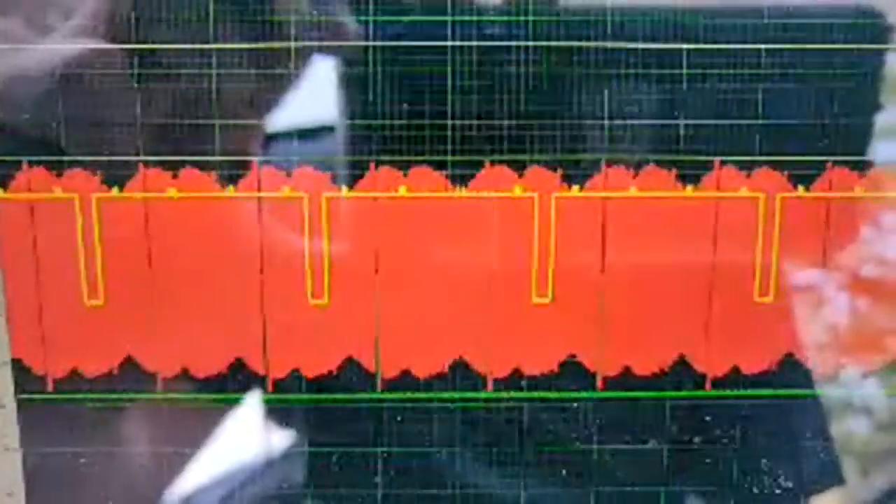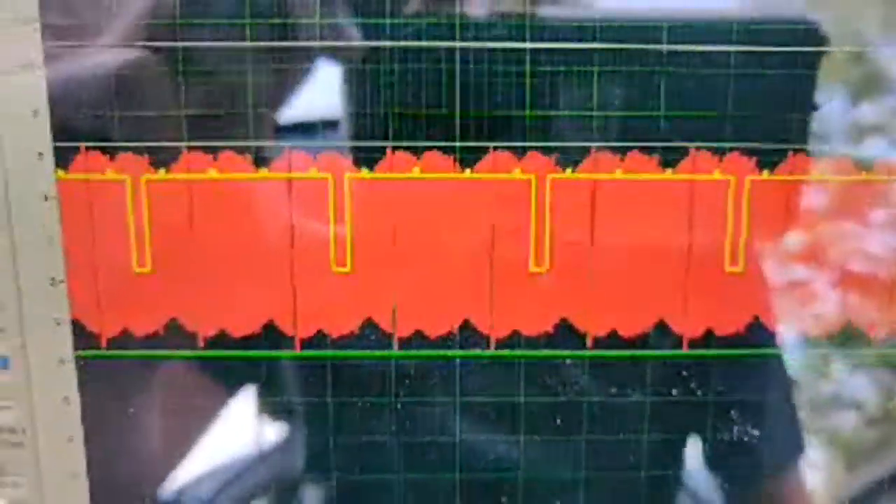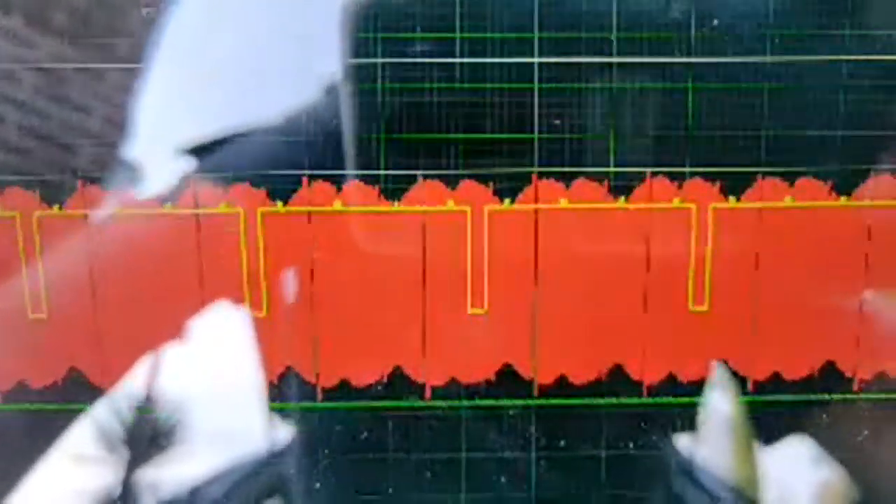It doesn't matter what voltage you had it set on - now I've got my cam-crank sync and I can count the teeth. No setup, no force, nothing like that. On the yellow trace we've got one, two, three, four - it's actually picking up the injectors firing. So imagine you had a misfire and didn't know whether it was mechanical or whatever - just by seeing the noise on that trace, the sample rate and vertical resolution are good enough that it's actually showing me my injectors firing within my camshaft sensor signal. How cool is that?